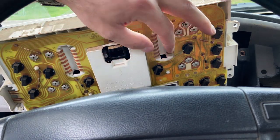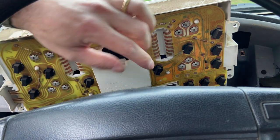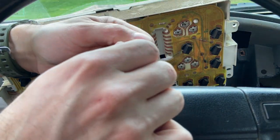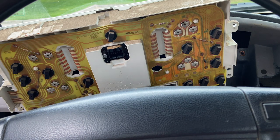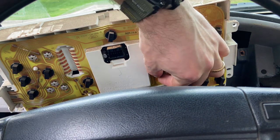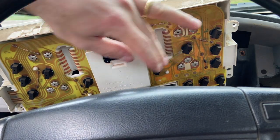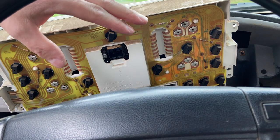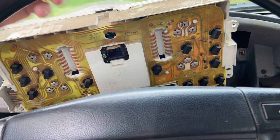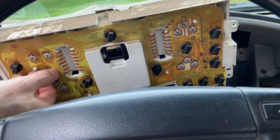I like to balance things out, so if I replace one side I also want to replace the other, because this one is more than likely still incandescent. There's the regular incandescent bulb — we're going to put an LED in there. Put that back in. The Speedo has looked really dark ever since I upgraded some of these to LEDs, so I'm going to swap that one out as well. LED bulb in. I'm pretty sure these were the ones I replaced before — still going strong.